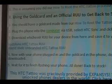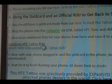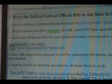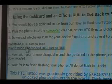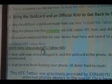Now your phone is plugged in. You're going to download one of two RUUs — the RUU is a ROM Update Utility. The top one here is for if you have a Vodafone Tattoo. If you have an unbranded Tattoo, then use the bottom one here. Click on that and let it download.